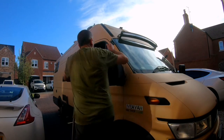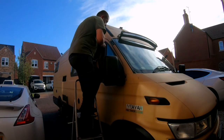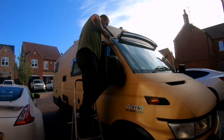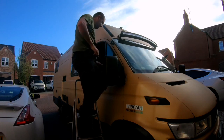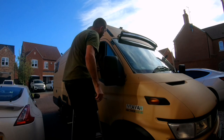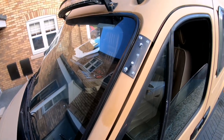There are five screws holding each bracket into position. Using a suitable drill bit, I'll drill the five holes — these just screw straight in. Then I'll clean off all that excess non-drying bedding sealant and do the other side.